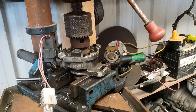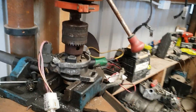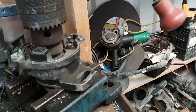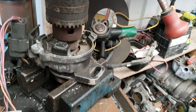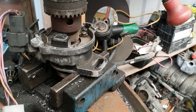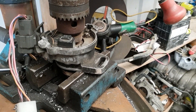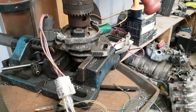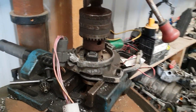This one's great because it's got an RPM gauge on it. It's 12-and-1. You guys familiar with 4AGEs will know there are 24 teeth on there, but we've got 12 teeth on our crankshaft and one tooth on our camshaft as the reference. We've actually got a distributor, so it's got those same 24-and-1, but we talk about the crankshaft teeth being 12, and that's how it's set in the ECU.